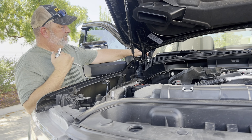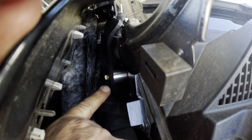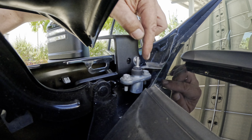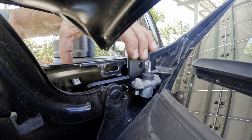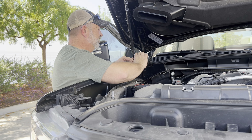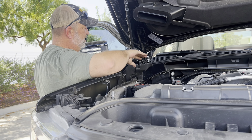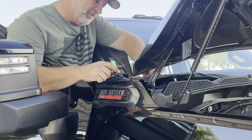This is what it looks like when you get it all wrapped up. That spacer goes between the bracket and the hinge where you took that bolt out. Just make sure you get a washer on here, and then that new Torx screw goes right here in the rear slot. Then you can put your antenna bracket back on. Now we can stick our foam back in - oh, it goes just like this. What's the button? There we go. Now you do have to trim this plastic cowl piece a little to make room for the bracket.